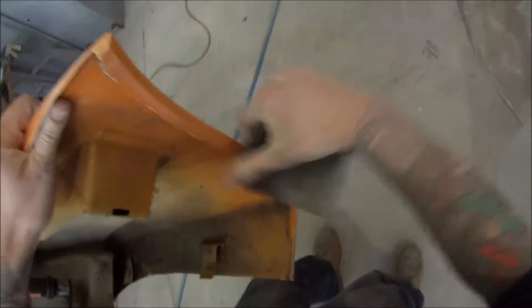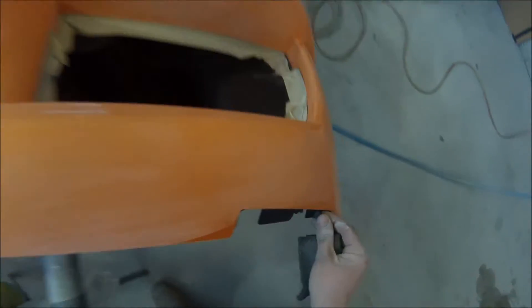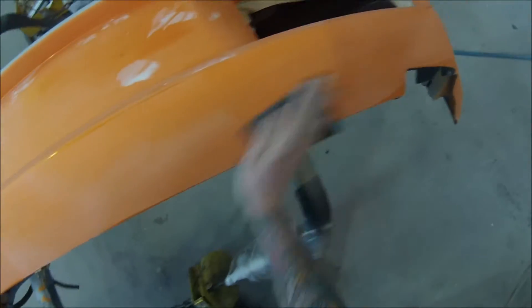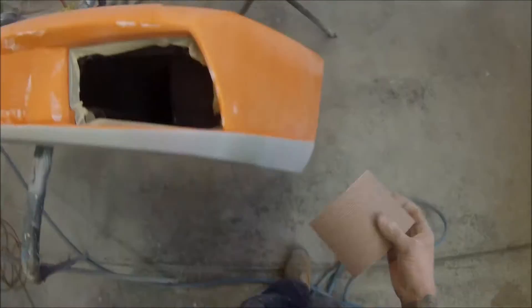Most of the time I would usually try to match the colour absolutely 100% and bring the colour right up the bar while fixing the stone chips with fine filler. But this time you're never going to be able to get the effect exactly right because it's a three-stage pearl. That's why I decided to just touch them up and clear over them — the ones that were at the very top.